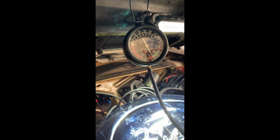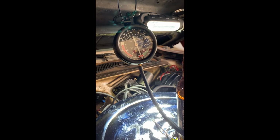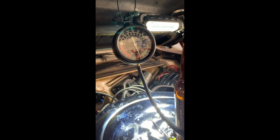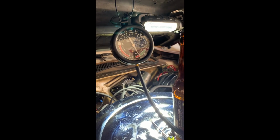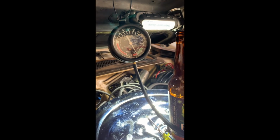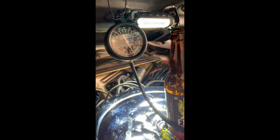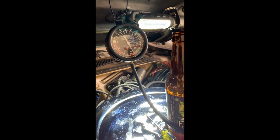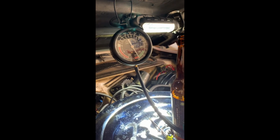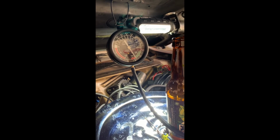Let's say I'm gonna twist this other one. See? I'm twisting it a lot. Look, I'm gonna go all the way closed. A little bit open. Listen to it. Listen to your engine. It's kind of like a Pokemon. You just need to listen to it. Try to get as much vacuum as possible. You need to wait. You don't just turn it and expect it immediately. So this is analog stuff. So twist both of them, one and then the other one.